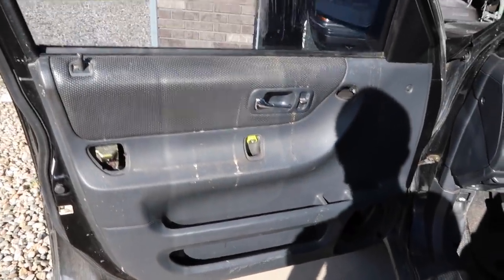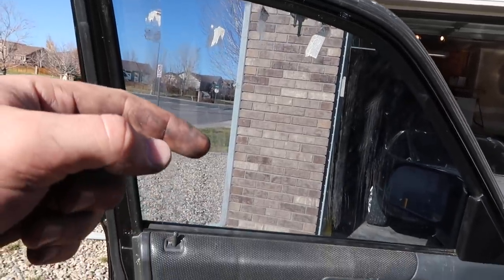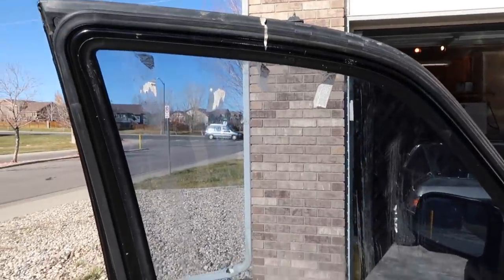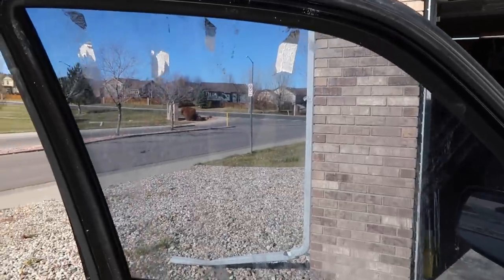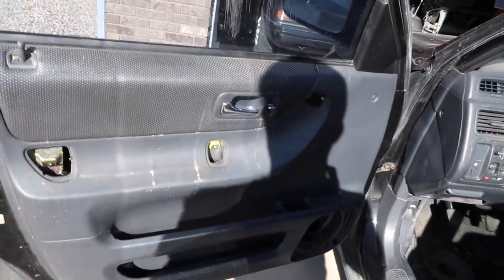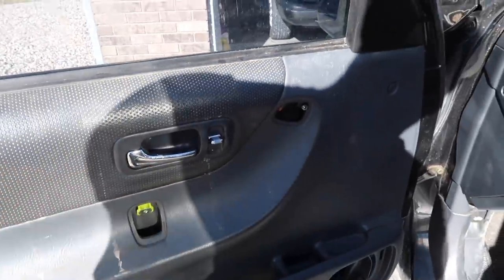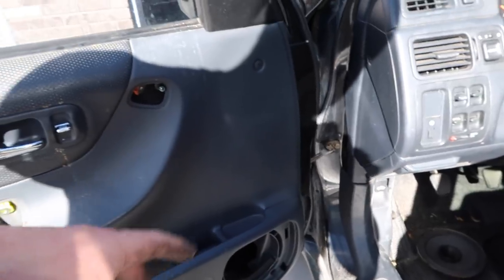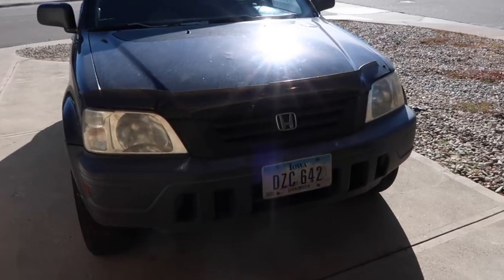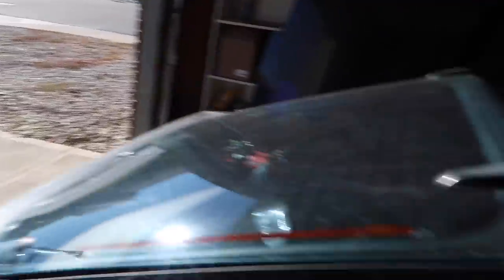I did get a used window regulator, so now it does go all the way up. But if I roll it down too far, it'll come off the track on the inside, so I'm still gonna have to get a new one. They're pretty cheap but I got this one for free, so for now it'll be alright. If you guys have a new one, you shouldn't have any problems. I got everything bolted up on the inside, I'm putting this back on with the little linkage put on, just gonna put the armrest on, put the speaker back in, put the grill on, and it'll be good to go. Now that I've got the regulator fixed on that - well, I can now have my window all the way rolled up.